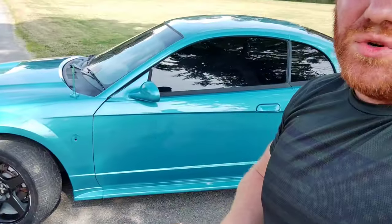This is one classic situation, guys, where it does pay to get a more expensive clear coat. The SMR42, I think they lowered the price to $150 for the medium activator kit. It always pays off, because when you run into these types of problems with really cheap eBay metallic base coats and the metallics are popping through, your lower solids clears are not going to save you. The SMR42 gets the job done. It really can make these cheaper, $2,000 to $3,000 paint jobs really pop.